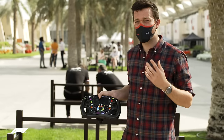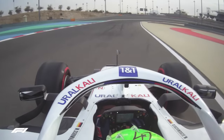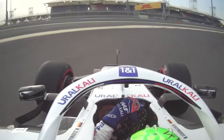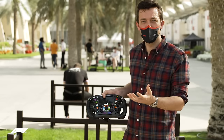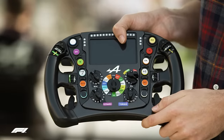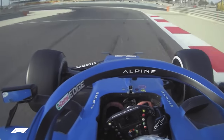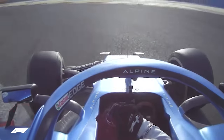On top of this, braking is very, very important in Formula One cars — it's more powerful again than Formula Two, and there's more you can do with it. You've got brake maps; brake by wire means you can control how much pressure you get at different amounts front and rear. Fernando's got his brake shape here and he can adjust that on the fly with this rotary. On top of that, there's brake balance up here, so you can change the overall balance rather than the actual shape of the map, depending on what you want, corner to corner as well.